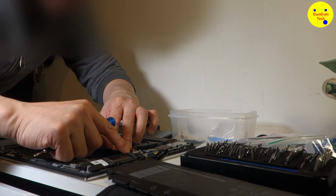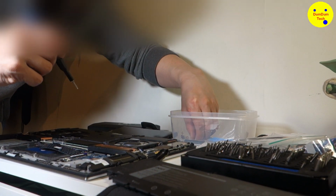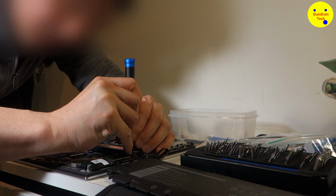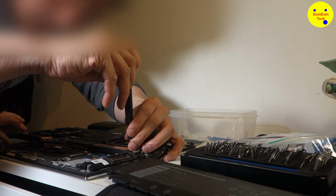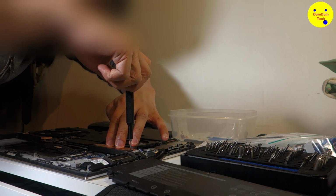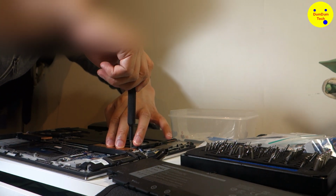Even using the correct screwdriver and the screw head, my recommendation is if it gets stuck, get a flathead screwdriver, which almost fits the size of the screw, and a rubber band to get it out, and undo all your M.2 screws using the flathead screwdriver. I found that really easier to do than using the crosshead one. Use the crosshead one to put the screw back in,